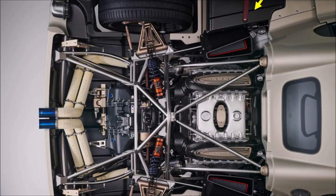The outside exhaust with the catalytic converter below is also the reason for the relatively wide tube frame, which then results in relatively short wishbones. These create a bit more track width change under bump and rebound, which increases tire heating and hence tire wear. But since this is a street car, the effect is very small.